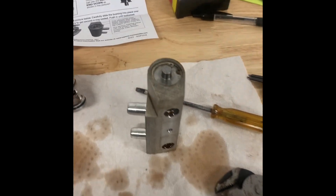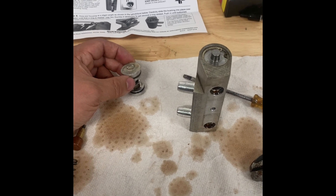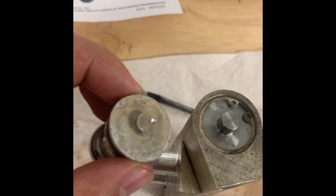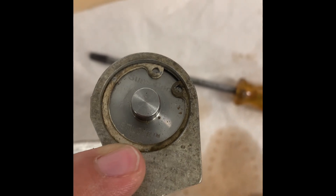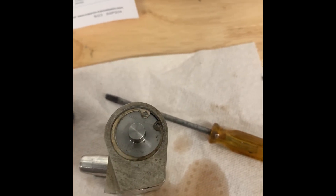Something I noticed: my truck has about 180,000 miles on it and I wasn't sure if this modification had already been done. As far as I know it's the original transmission, and a lot of people out there have their transmissions getting hot and cooking around 100,000 miles. If this modification has already been done, I noticed the top piece is marked with the STL 010 part number. If you're not sure whether your truck has had it done, it might be worth taking a peek at the top to check.